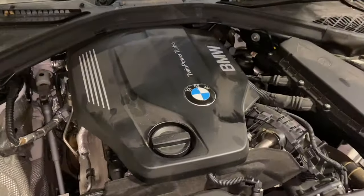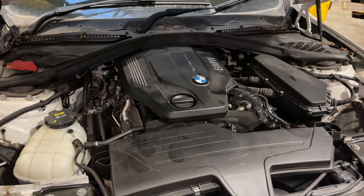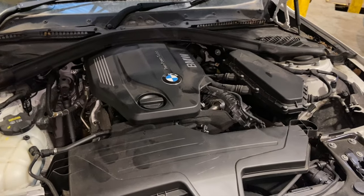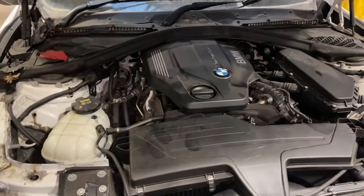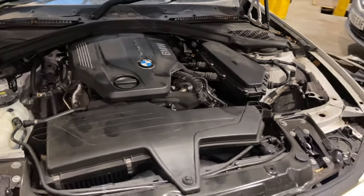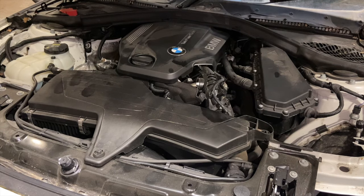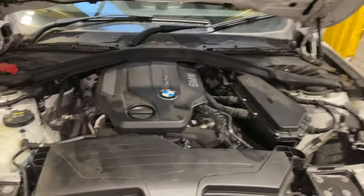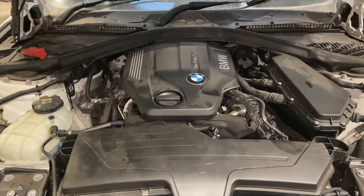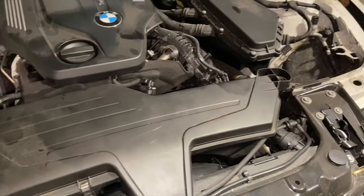Just filled it up with 5 litres of oil and put the oil cap back on. Next, we've still got the air filter and cabin filter left to change, but I'm going to start the engine up now and just leave it running for a few seconds. It just works the oil around the system quickly and fills up the filter housing. It just took a few seconds to fire up — with the fuel filter having been off it just needs to drag the fuel back through. Just let it run for about 10 seconds max to get the oil circulated.